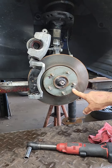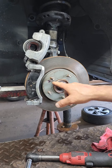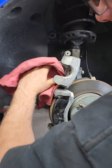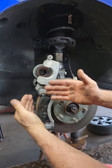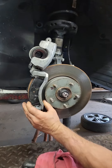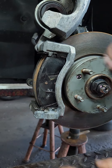You could tell it definitely wasn't done here. The problem here is wheel bearing grease — somebody was trying to resolve a noise coming from the brakes and thought they were going to make it better by putting grease on all the stops. That just enables the brake stuff to move more. What's happening with the aftermarket pad is it's clicking in the bracket — it's not necessarily a hardware problem, it's a problem with the fitment of the pads.